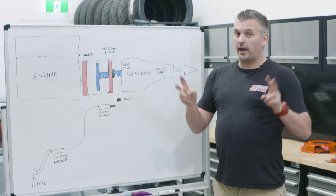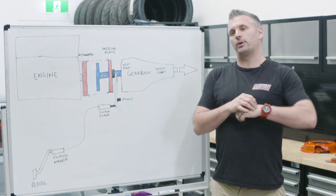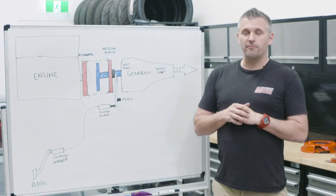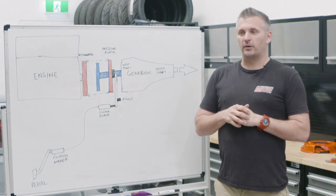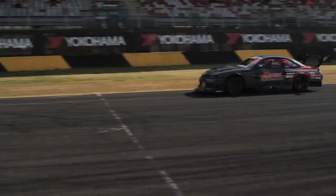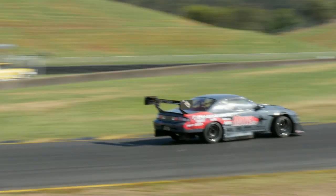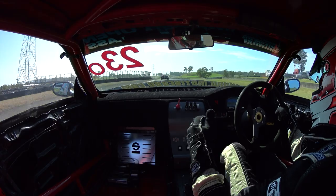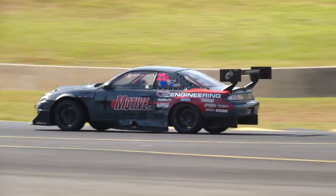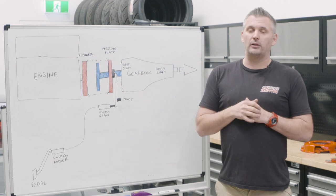So a heavy — or I should say a normal — flywheel and pressure plate keeps the car really easy to drive. So all you people out there that go 'I want a light flywheel for my Silvia for the street' — no, you don't. It won't drive better. And you're going to say 'but I'll get better throttle response' — really, are you going to notice it? In a circuit car or time attack car where you want the revs to go up and down very quickly, you will notice having a light flywheel. But honestly, to get a really big improvement, you need to lighten the flywheel, the pressure plate and all of the clutch plates, bring the diameter right down, and get yourself a proper dedicated race clutch. So don't always be quick to go and get a light flywheel.